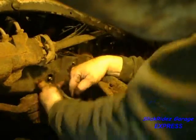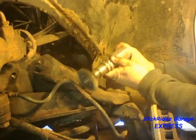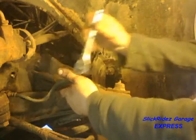First, I'll detach the brake hose from the hard line. Blowing the fitting off helps keep debris out of the hydraulic system and penetrating oil helps things come apart easier. I'm using a flare nut wrench when detaching the hard line so the nut is not damaged. Next, I'll remove the brake hose retaining nut, then push the hose fitting through the frame. Now I'll wire brush the brake hose bracket retaining nut, then detach it from the upper control arm. This is not a blind fastener and must be held with a wrench from behind.